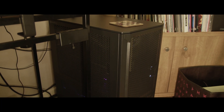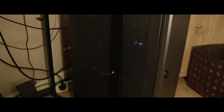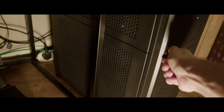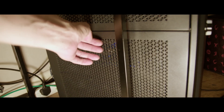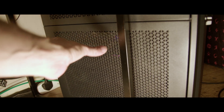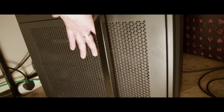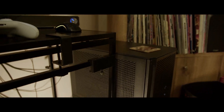One other interesting thing I'm finding with this case: because it has holes on the side it's effectively an open case. The big giant fans are sucking air in, and I can feel warm air blowing out the back — but unusually I can also feel warm air blowing out the side because the GPU exhausts air out the side and it just comes straight out of the case, which I think is really helping. The CPU temperature inside the case is 63°C — that's pretty good.